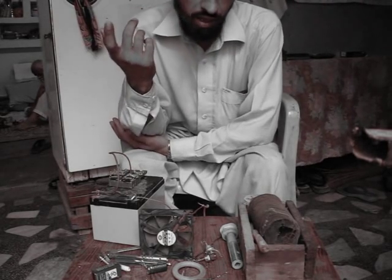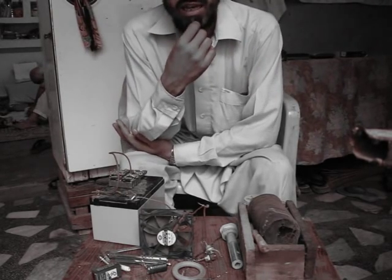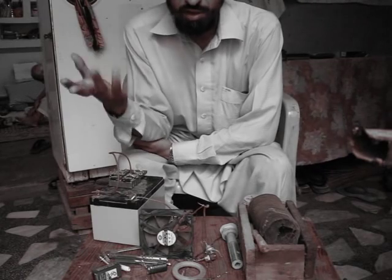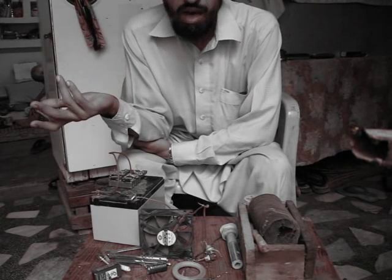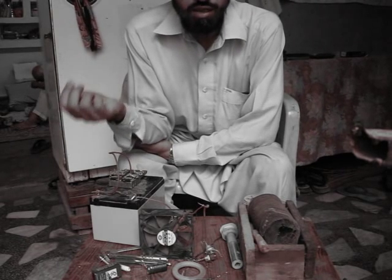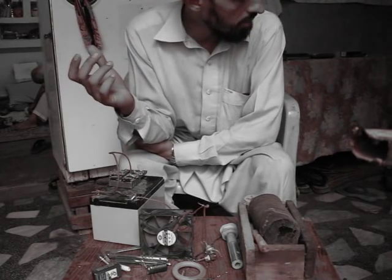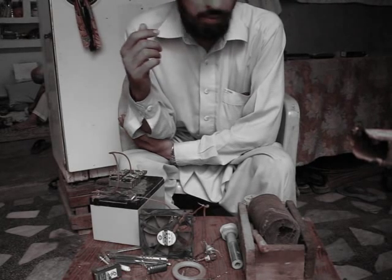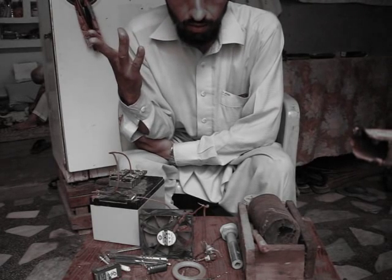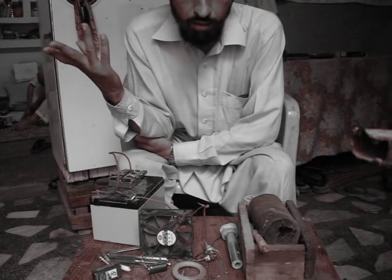In one of my electric bikes, as I have discussed earlier, I have made a controller all by myself following a circuit diagram that I found on the internet. It was pretty successful after modifying it time after time. I managed to make it work on my electric bike. It was not meant to handle that much power, but right now it is handling a lot. I am running at 60 volts at about 12 amps maximum, and it can handle up to 30 amps with a burst.